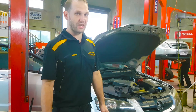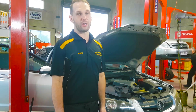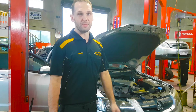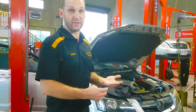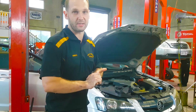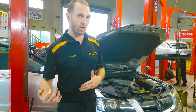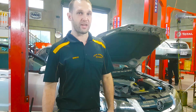So it's something quite common — a V6 Alloytech VE Commodore, and it's got a dead misfire on this one. There is a check engine light up and there's a cylinder misfire code. Like most modern cars, it's going to shut down the injector. So make sure you're aware of that. If we go and start doing our tests without clearing that code, the injector won't be getting a command — don't let that throw you off.